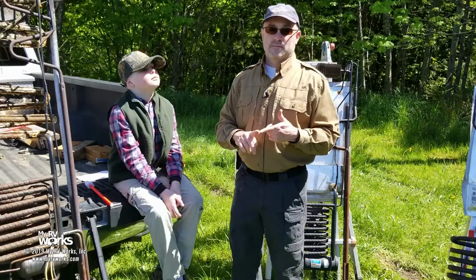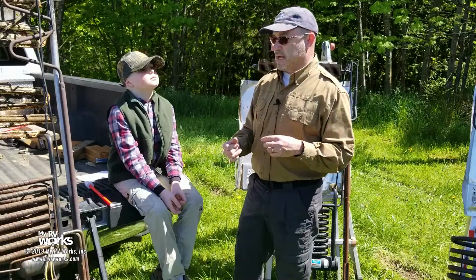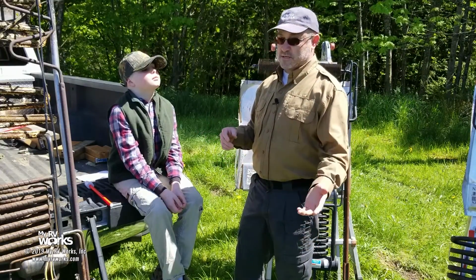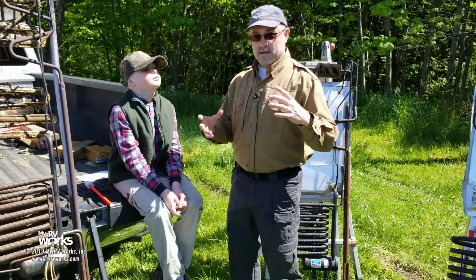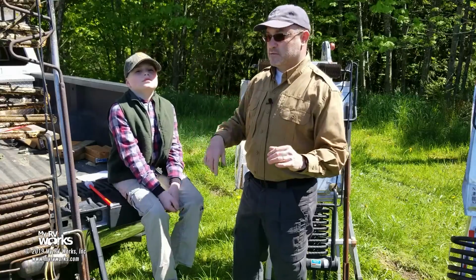Now, we've talked about the principles of ammonia, why it's a great element to have in here because of the vaporization. We talked about how it could readily be absorbed in water, how it can boil off. We talked about the vaporization at -28. Water is there because ammonia is readily absorbed into the water, and you can boil the water and the ammonia pops back out. Why hydrogen?